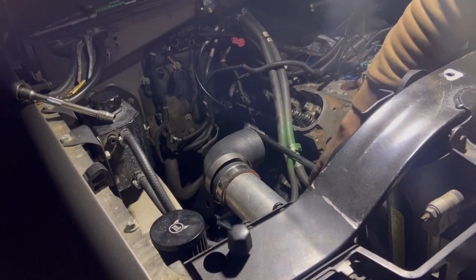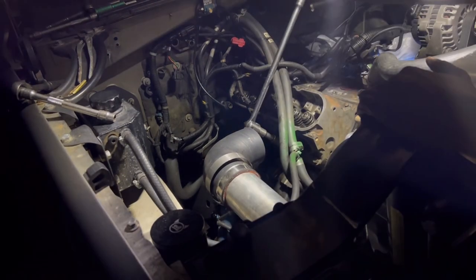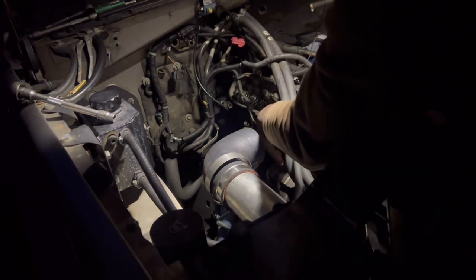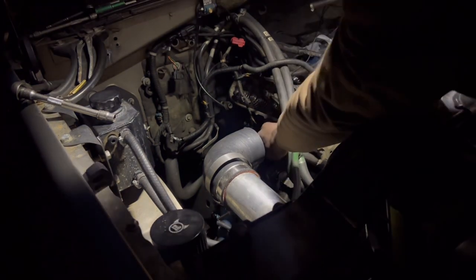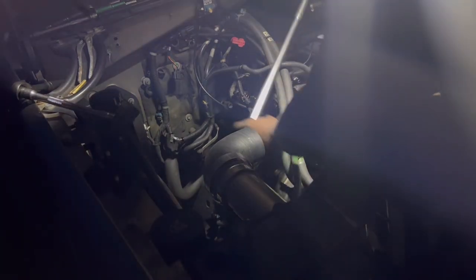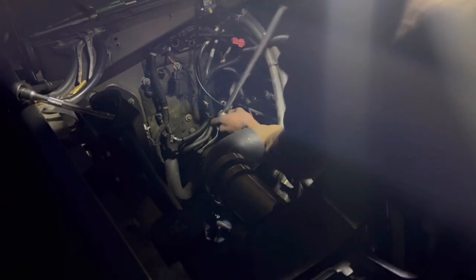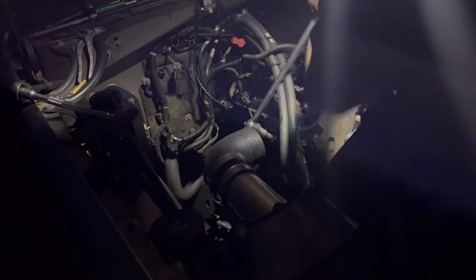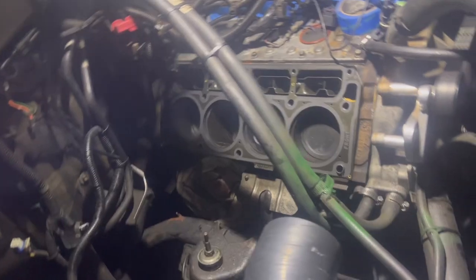I am removing the old heads, which is amazing and feels good. The reason I'm doing this is because the exhaust bolts on that back side for each cylinder head broke off, which was causing the exhaust leak and not allowing the turbo to keep spooling through idle. I thought about saving the heads, but I tried on the other head and messed it up trying to get the stud out — but it is what it is.